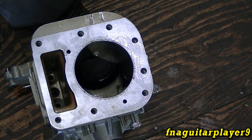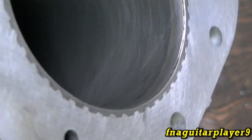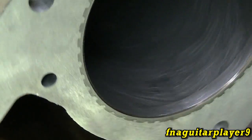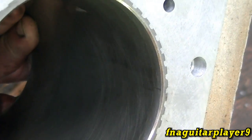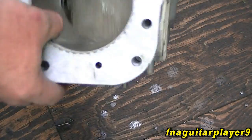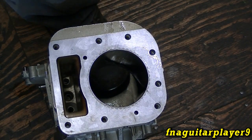You don't want to go crazy with it either, because it usually doesn't take a whole lot. If you do it too much you're just taking the life out of the engine yourself. That's about what you want it to look like. If it's good and even, great. If you start seeing a dull flat spot, it's usually a wear spot or the cylinder is out of round — you can usually tell just after a couple of seconds what condition your cylinder is in. I want to do just a little bit more to even out the top, then call it done because I don't want to overdo it — the block is in good shape anyway.